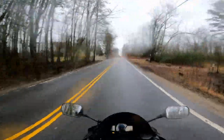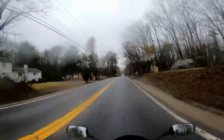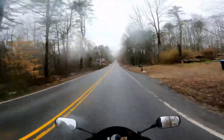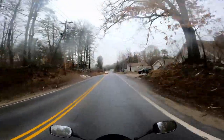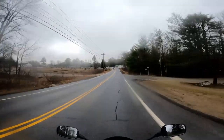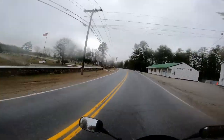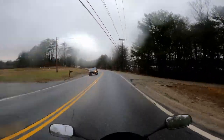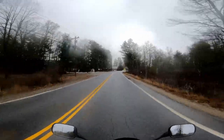It does sound amazing. For a track bike — for what this is really designed for — perfect. Although it is so loud that this bike is not allowed on some tracks around here. They have decibel limits of around 92 to 95 dB at 50 feet, and this is right on that line. So I'm going to try to make a DB killer for it — they don't actually provide one for this exhaust system. The issue is if they say stay under 8,000 RPM to meet the limit, well, a 600 wakes up at 7,000 — so that's basically useless.